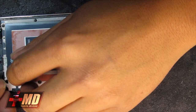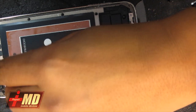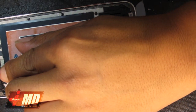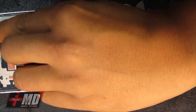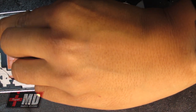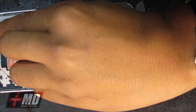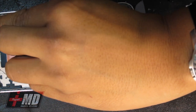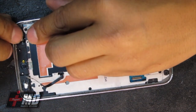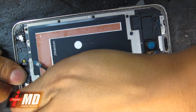What you need to do now is make sure there's no glass lying around — when you put the new LCD in, any glass fragments can cause a crack. So you've got to be very careful not to damage any of these components. Let's look at the flex cable here. I'm clearing the LED out to make sure the touch LED actually responds. I'm also going to remove some of the glue off.